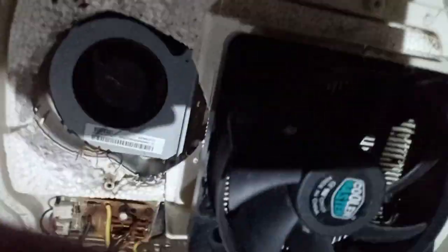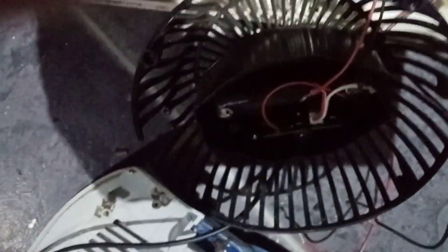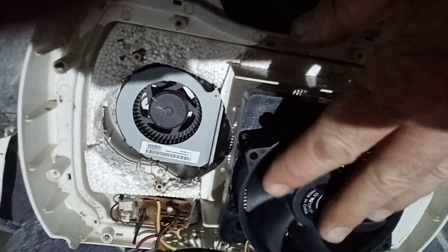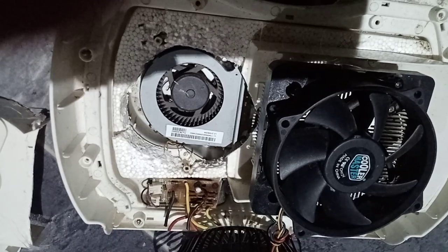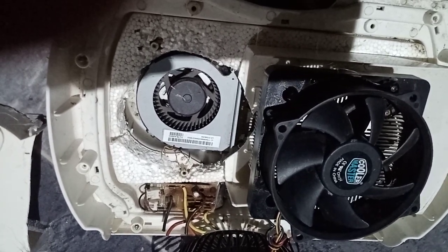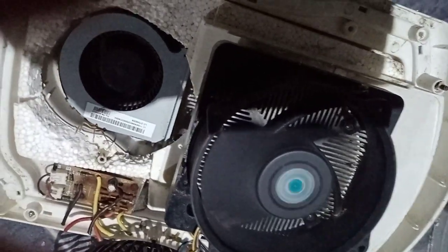Do a quick test of the motor to make sure it's running. Adjust the voltage/amp control to get different speeds. It's worth checking your motors at this stage. If you're not using the additional fan, put a switch in and wire it to 12 volts. These fans only draw about 0.6 of an amp, so use a 1.5-amp or maximum 2-amp fuse at 12 volts — don't go higher than 2 amps for both fans connected together. Quick test confirms the fan is working.